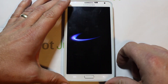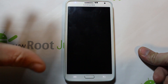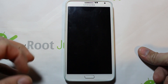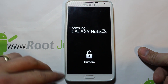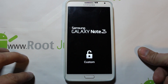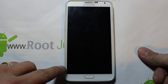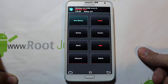From here we can basically just reboot the device — power, restart. On reboot you should see the Safe Strap splash screen. Click on the menu button or the screen and it'll get us into Safe Strap. This is custom just because I've edited some things — I haven't tripped my Knox sensor yet. Hit the screen and it should boot us into recovery — and here we go, we're in recovery.